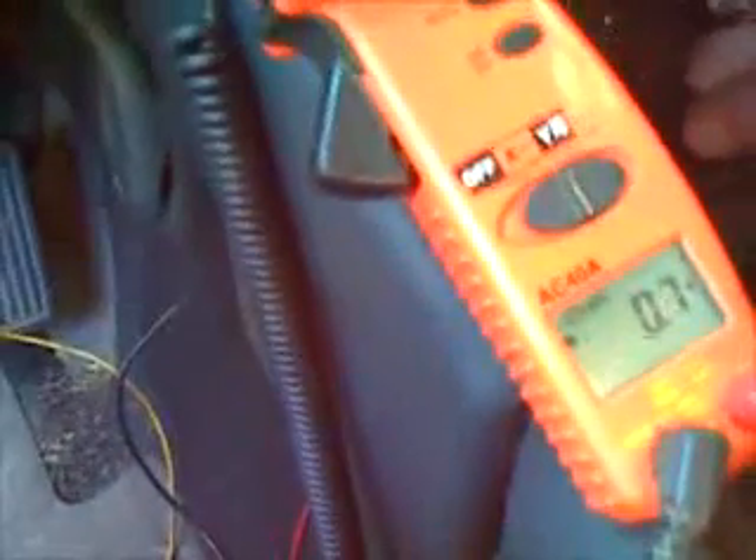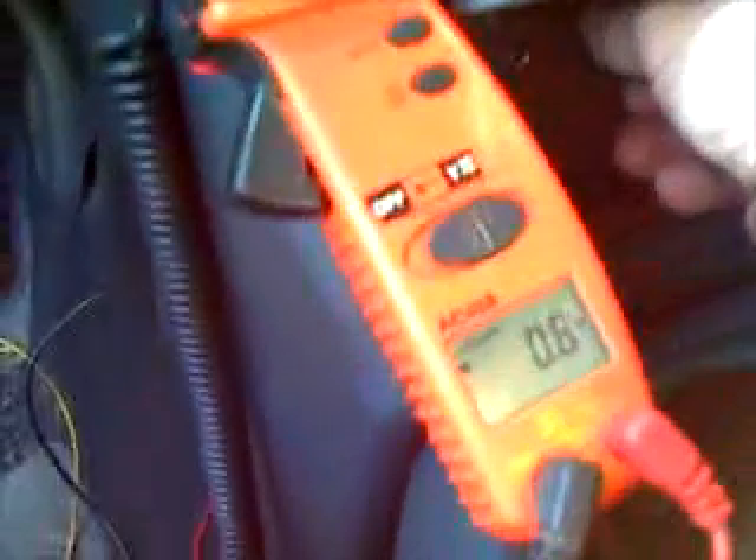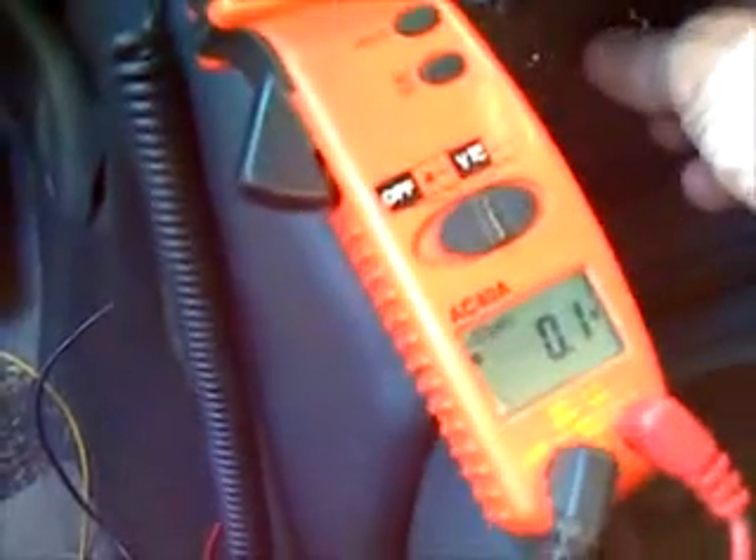Since the last time, several people asked me about the oxygen sensor controller. I've tapped into the leads and picked up a simple DC voltmeter to show what I've done. When I mentioned adding 0.3 volts to lean the circuit, this circuit allows me to do that. It's close to a full volt — it's lean — but it gives me the ability to play back and forth. I haven't found a sweet spot yet; I've been running approximately at the middle of the dial, set to where the engine seems to perform the best.